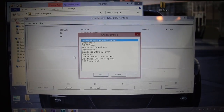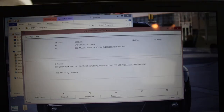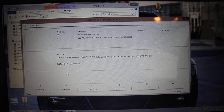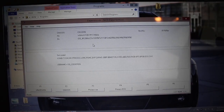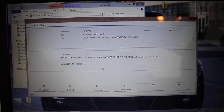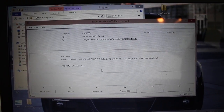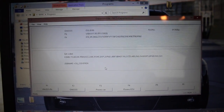File, load profile — Expert mode profile. Right now you have all these modules listed here. Go ahead and click Process Cars. It will take some time — it's going to basically reset all the programs back to whatever you have listed for your FA values. Since you removed one and added one, it's going to code all those values back to the certain modules. If you have stuff coded already, in the description there should be a link to the post with the certain values you have to add in order to change the systems without having to wipe everything back to stock.